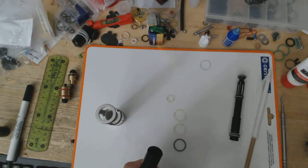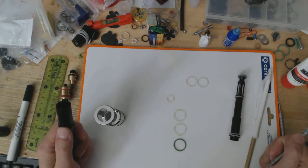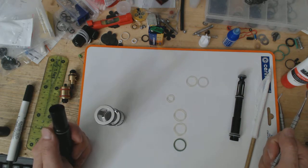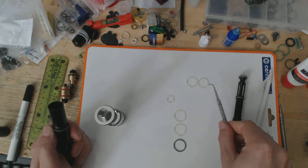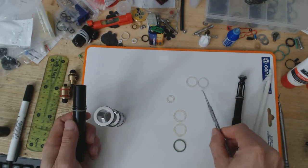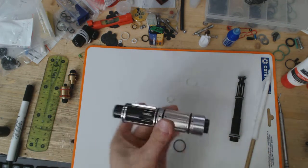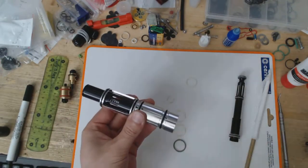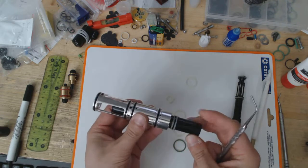So what you need to do is replace it with another O-ring. Normally when people tell me everything should be fine just because they replaced this O-ring with a new one, who cares about the new one? It should be a proper one. It can be an old one, but a proper one. As you can see, there is almost no difference, or even this O-ring which I took out from the bolt seemed to be slightly bigger. But if I replace it with another O-ring from another manufacturer, you can see that the bolt is not moving at all. So this is much better for cold weather conditions, or high humidity, the conditions which we have in Russia.